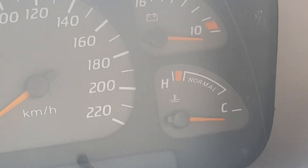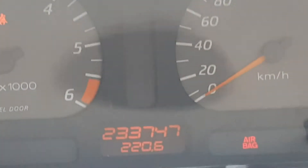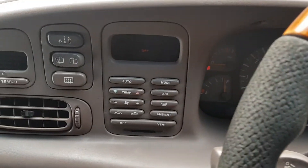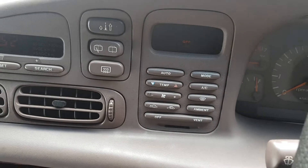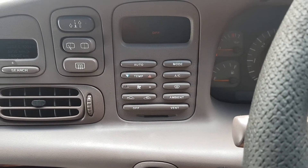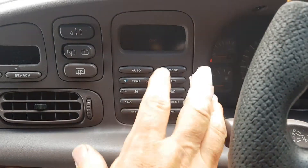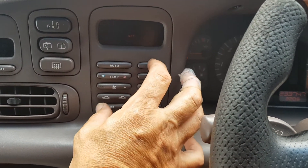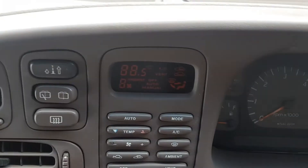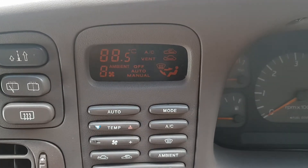It's basically one click, two clicks, and the ignition is on. The dash lights up. We go over to our air conditioning unit, and to start the test, we press two buttons — Mode and Off — simultaneously at the same time, and then release. The display here is now in full display mode, and the test is actually running right now, live.